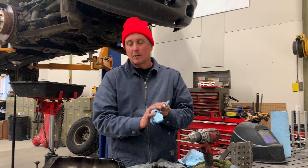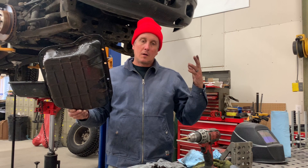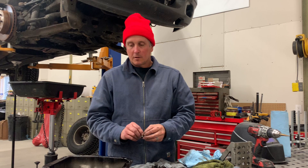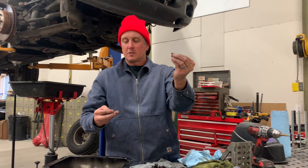What I'm going to do is put a drain plug in this stock pan so that after I run it for a little while I can drain and refill that fluid more often, keeping it clean. It's a simple little setup — a 5/16 bolt, a 5/16 copper washer like the ones you can get from any auto parts store for banjo bolts and brakes, and then a nut. I'm going to drill a hole in the pan.